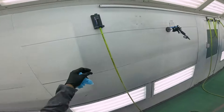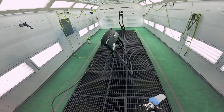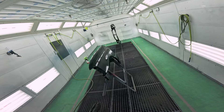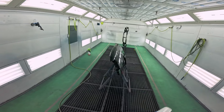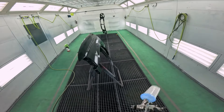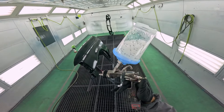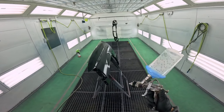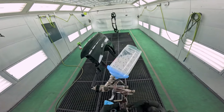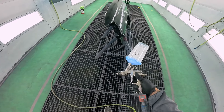So we are ready for clear coat. I cleaned this gun and we're going to set it up just a little bit higher PSI this time — I did my sealer at 25, my base coat at about 22, and I'm going to spray clear coat at 28. A little bit more pressure just atomizes a little bit more. Wide open fan, wide open fluid, 28 PSI — again using the Eastwood CC500. You can use that discount code Joel10 at Eastwood — it knocks 10% off anything: spray guns, paint, welders, whatever.